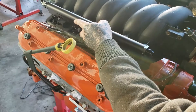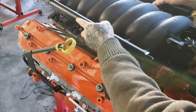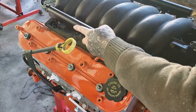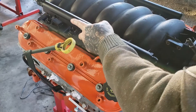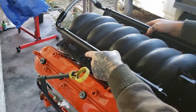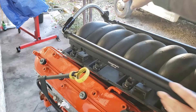Your intake will set down just like so — it's got little dowels, and those dowels help center it up. So if it doesn't center up, you need to move it around until it does. It's centered up here and here, but I'm being held off — something is holding me off, so I've got to remove that.